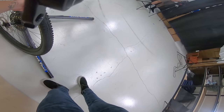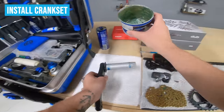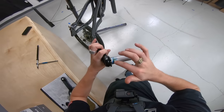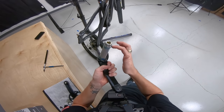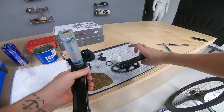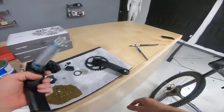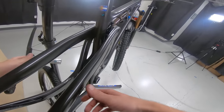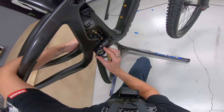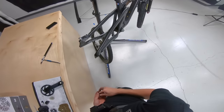I'm also going to throw in the crank while I don't have a wheel on the bike — it makes my life easier. There's a little bit of grease provided by SRAM on here, but I usually add a little more; you can never really have too much grease and you don't want to go in dry. I'm going to slide this non-drive through the bottom bracket. As you come through, be super careful you're lined up — if you're not, you'll knock one of those plastic DUB spacers out, which is a pain to get back in.